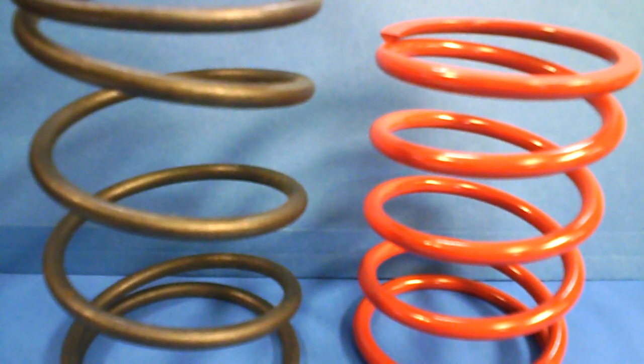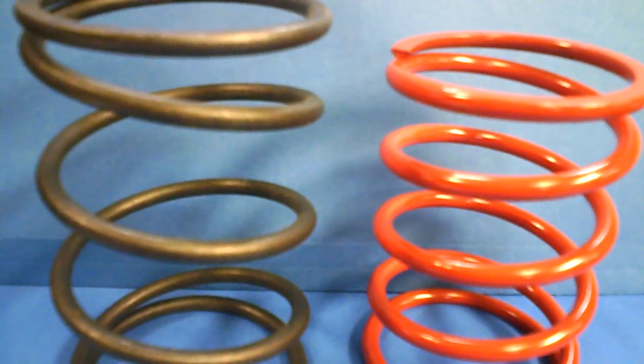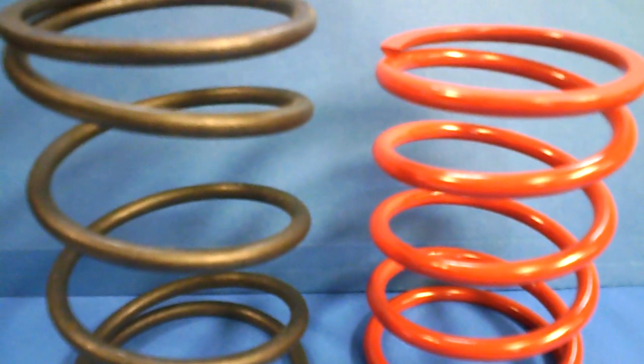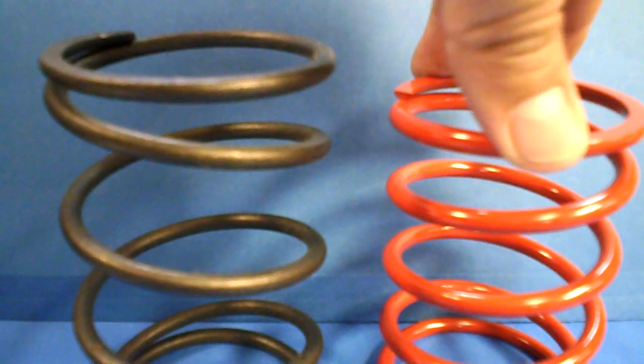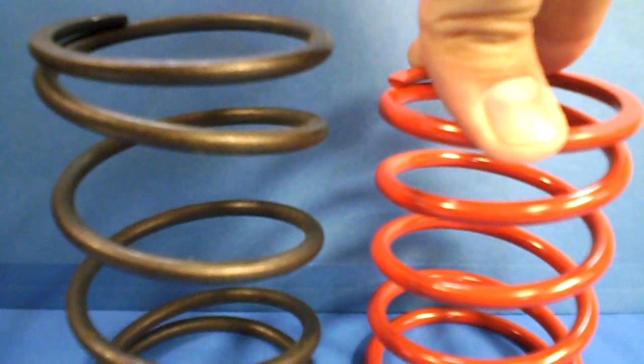Without the rear force clutch spring, you're not going to get that takeoff. It also sets the RPMs — you have low, 1,000, 1,500, 2,000; you've seen some that are 2,500, some that are 1,800. They make them in different colors: red, yellow, blue are the normal colors. Some of the Italian companies make them in green, orange, there's purple.